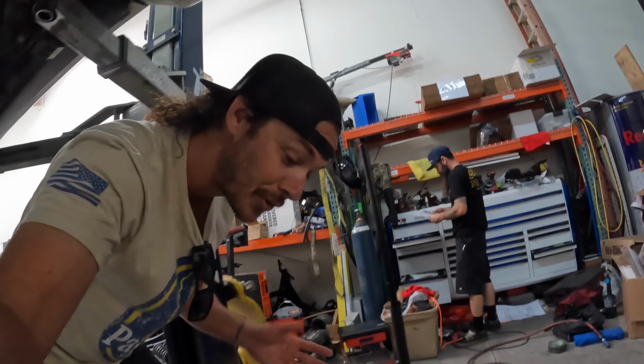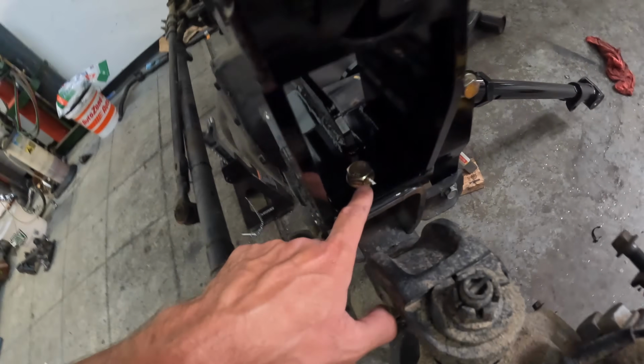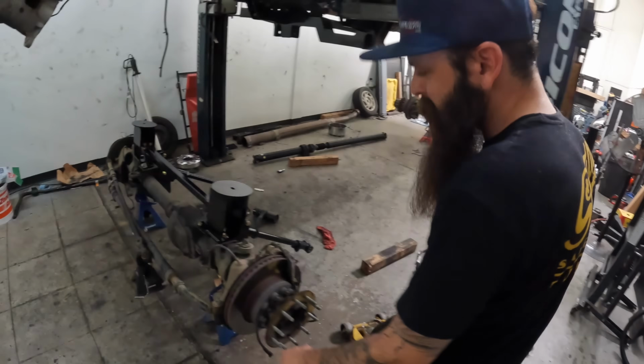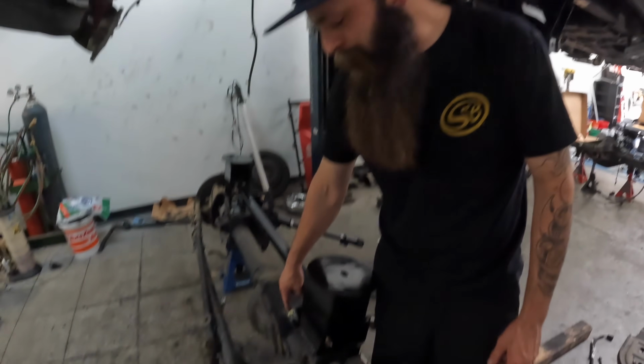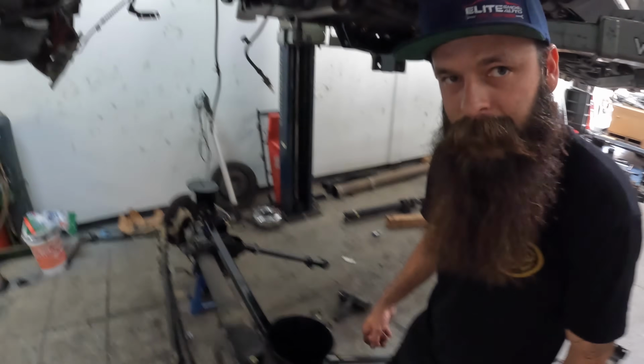However, here's a little tip and trick that I watched from Zach. Notice right here, he's got a little paint marker on his bolt. Y'all should do that. Zach, why should they do that? It's a witness mark. And we're using Revlock Race Supplies witness mark paint. A lot of the race guys will do it, and you make a mark. You witness mark it, whether it's paint like that, a marker, or a paint pen.